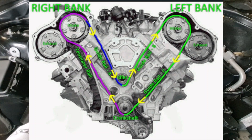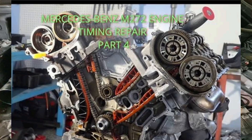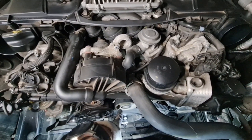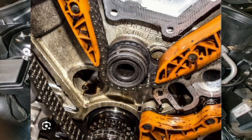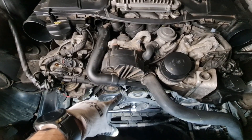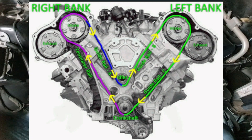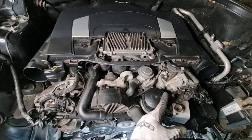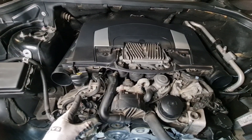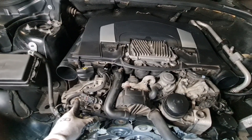The cam chain goes around the cam sprockets — the intake one and the exhaust one — geared to the camshaft for the intake. We have two camshafts with sprockets, and the cam chain goes down to the balance shaft sprocket and up to the right-hand side bank. If that balance shaft sprocket wears, it causes excessive slack in the chain. Because the engine rotates clockwise, it first drives the left-hand side cams, then the right-hand side bank — so it always affects the right-hand side bank, producing a delay in timing.